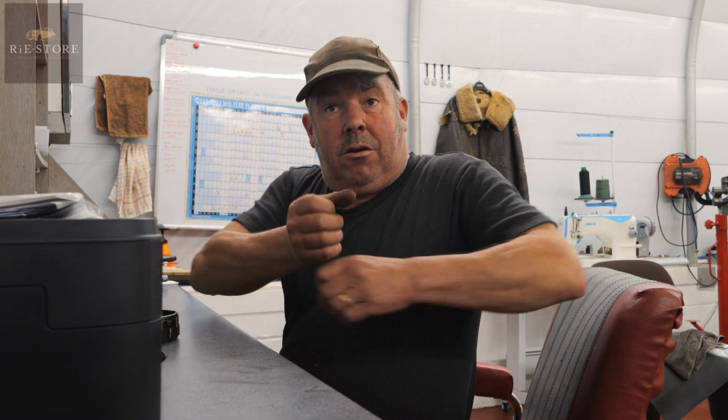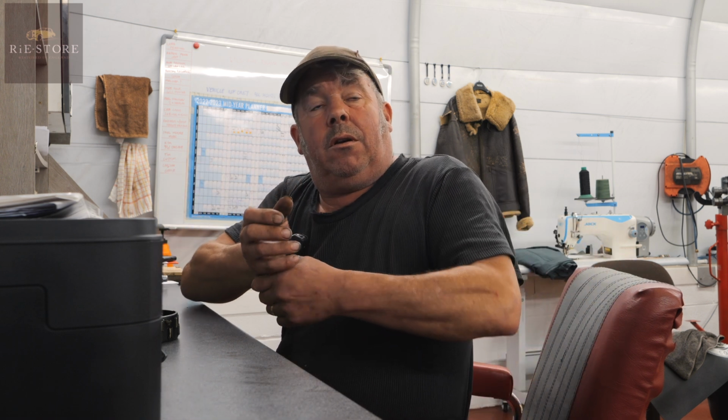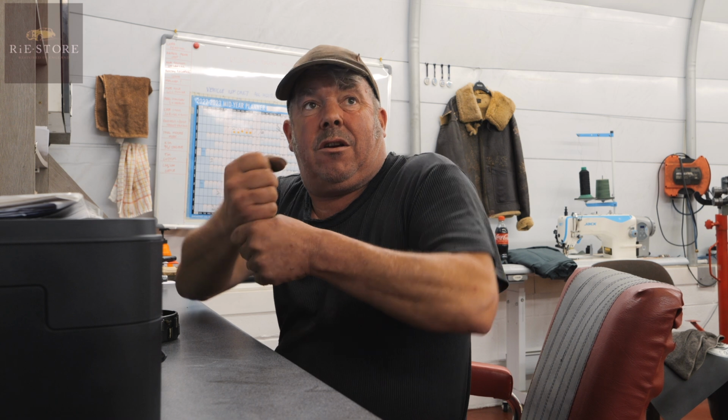But realistically, a lot of the reproduction exhausts are the same old, isn't it? Reproduction parts. But all you can do is use that exhaust assembly paste, whack a load of that round it, and it bakes off hard. But if it's got any movement in it, like rattling, it will just fall out. I have seen somebody clean the pipe up and put solder around it. So you can, because the solder's soft, wedge it, just turn it and wedge it up in the hole. But it's such a ball ache of a thing to line up, you don't know if it's in the right place.